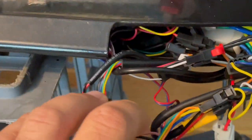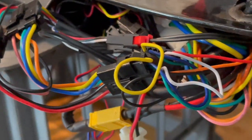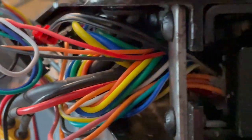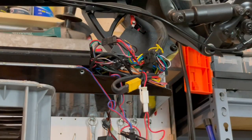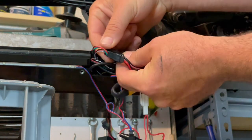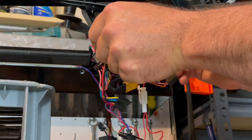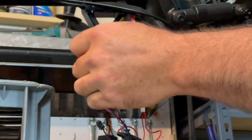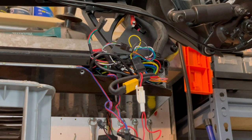As we come across here, see this little connector that goes from your immobiliser to the connectors designed to connect it to the controller on the handlebars - in order to make things easier when running the cable, I actually disconnected that, fed it through, reconnected it out here, and then pushed it back in. Let's go ahead and disconnect this key ignition, and now I'm just going to connect the immobiliser directly in there. That we can actually remove, which will give us a bit more space.